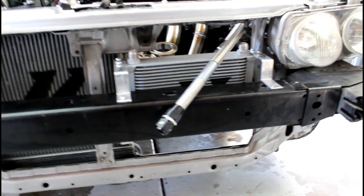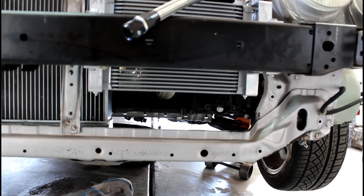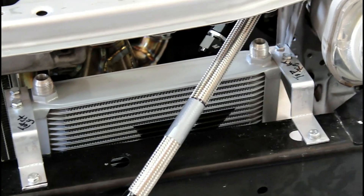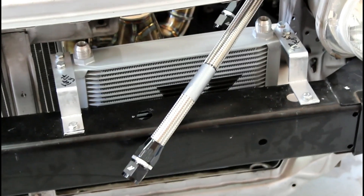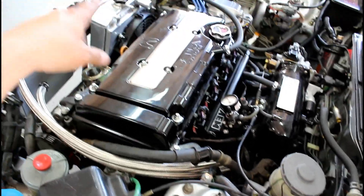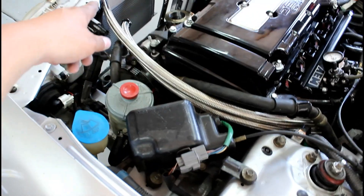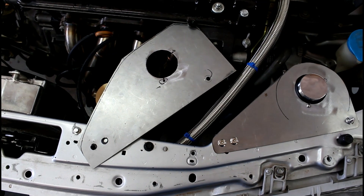The oil cooler is now mounted. I bent up some one-inch wide aluminum in the vise — two brackets on top, two on the bottom — with the bottom ones set farther in so the intercooler clears. We marked the hoses to be cut and fitted with 90-degree fittings since this is a universal kit that came with straight fittings. The oil lines are going to run on this side of the car because the exhaust runs the other way, going from the sandwich plate across and into the cooler.